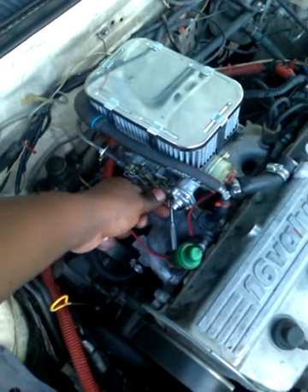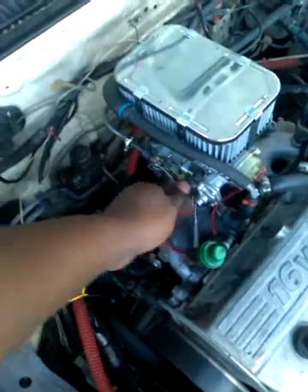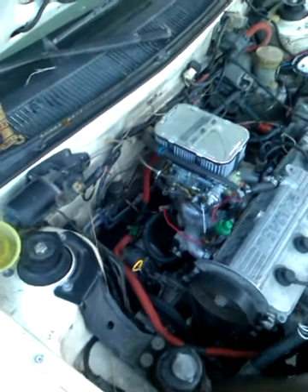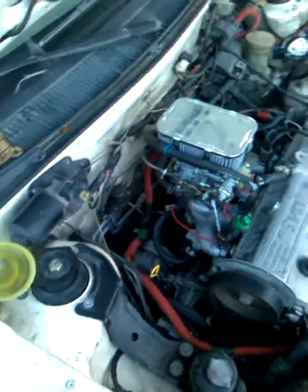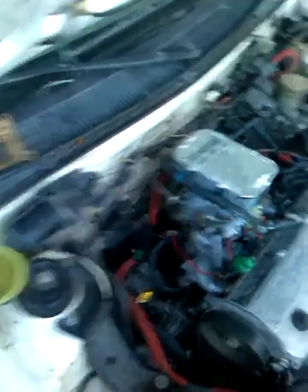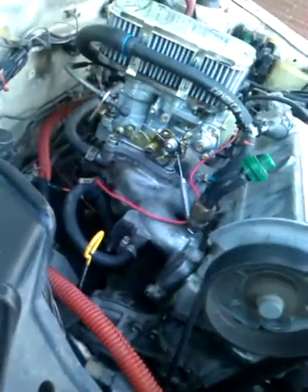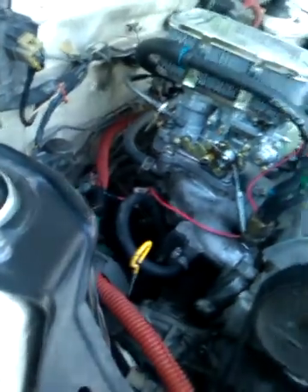This is just one plate opening. For both plates — wow. The only thing is that both plates open around mainly 4,000-5,000 RPM, and I really doubt that they are going to use the second plate ever. Because it runs really, really good. I'm not sure if the opening of the second plate is adjustable, but it's okay.